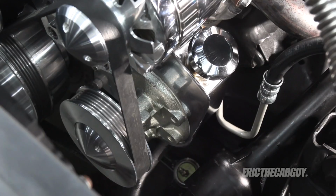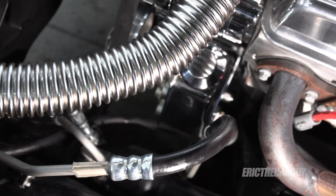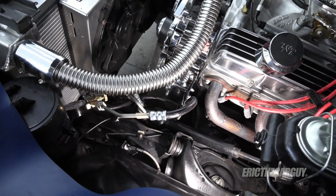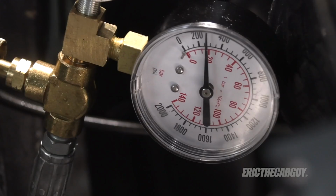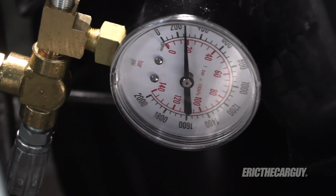Well, somewhere in there, I lost the batteries to my microphone and audio along with it. So I'll catch you up about what I've done up to this point. I have gone in and I've put the old pressure valve in the new power steering pump, and now I do have pressure. In fact, operating pressure, I believe, is somewhere just shy of 300 PSI. So that's encouraging. The old pump, I think, wouldn't even do 200 PSI.